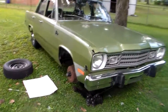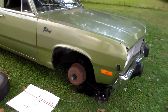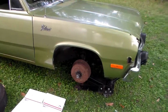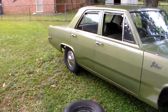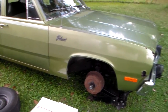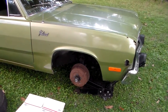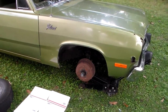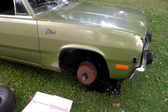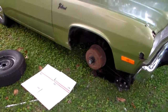People will say you need to make sure they're adjusted, and I see that all the time when you talk about drum brakes on forums. Well, that's true — they need to be adjusted. But this vehicle is modern enough that it has self-adjusting drum brakes. It means the brakes back there and up here work exactly the same way. They have self-adjusters, so when you back up, they adjust to the correct distance between the shoes and the drum.